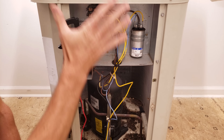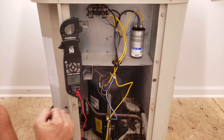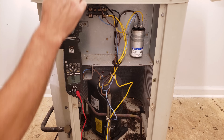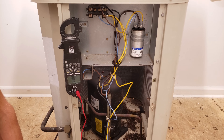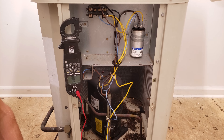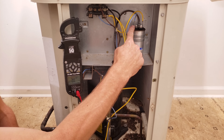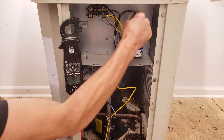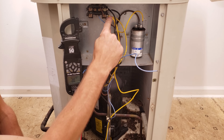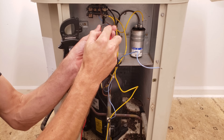You have completely open access to get into this compressor compartment. In normal cases it's not that easy — you may be able to get to it from down low or take the condenser fan off the top, but it's just not easy. You want to start your diagnosis up here at the wires anyway. You can see that this is connected to the Herm terminal. We're going to pull that off — this yellow wire connects here and this black wire connects right there. So we'll go ahead and disconnect those.